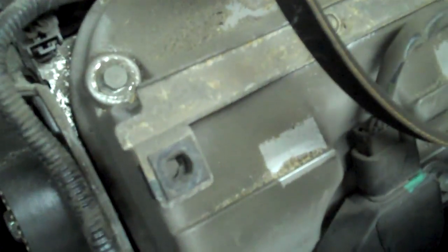The next thing you want to do is pull off the idiot hood. To do that, it's got 4 10mm bolts that go in here, here, here, and here. You have to pull that off to get off the secondary idiot hood that goes over the valve cover. To do that, you just twist the little screw things on each end and they're out of here.